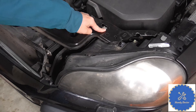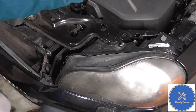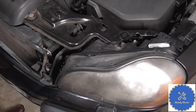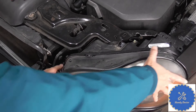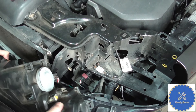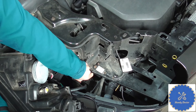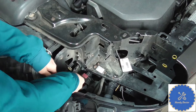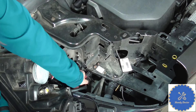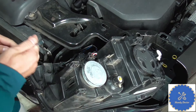For this car it's so easy to take out the low beam light. There are two metal bars here — this is a shorter one and there's a longer one on the other side. Take them out and put them somewhere safe, and this whole thing will come out. There is a connector out here — you just pull it out. Sometimes you may need a screwdriver to help you with that. Pull it out and it will come right off, so now you can let it sit here and check.